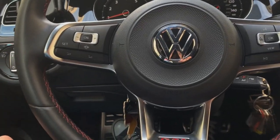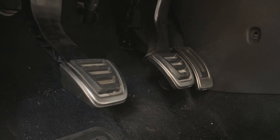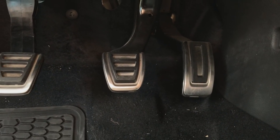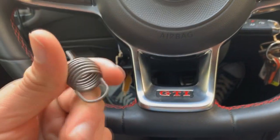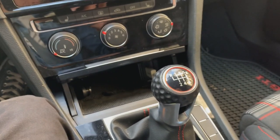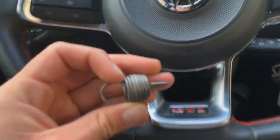The second thing I did was the spring removal. Here it is — the spring for the clutch. This basically connects underneath the clutch pedal. You just want to remove it. It takes like five seconds to do it. It's a free mod and it helps remove some of that synthetic feeling. It's supposed to help make the clutch more soft and lighter weight. But if you're the driving enthusiast who really enjoys the manual vehicle and wants to experience that firsthand and get that more raw feeling, definitely removing the spring will give you a bigger advantage in between shifts.